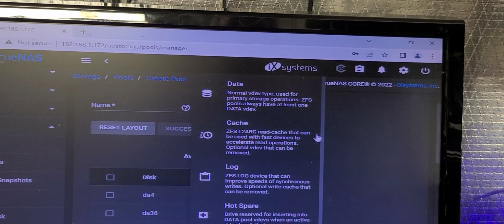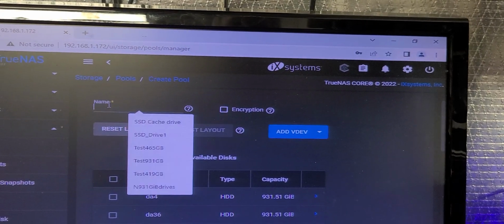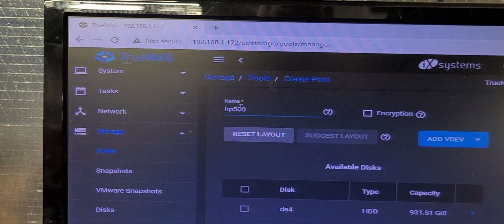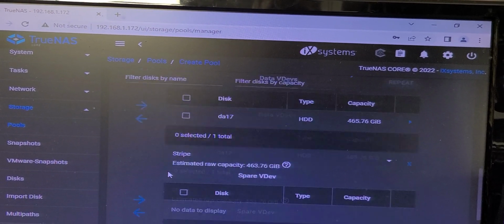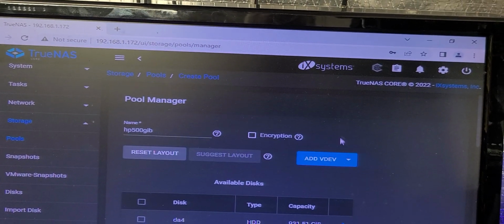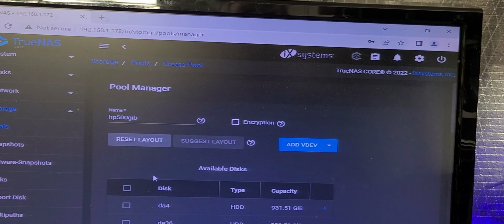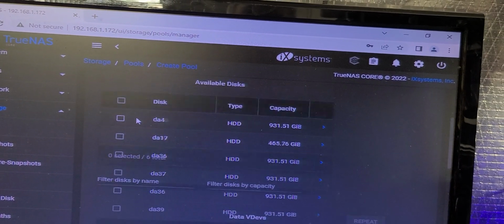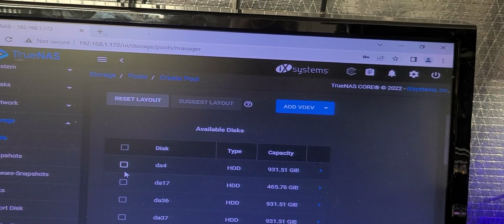Well, you can actually go into and create hot swaps, okay? And by creating hot swap, 500 GB, I can then state and configure this drive to be what I want it to be. And in this case, I want to enable the hot swap capacity. And I'm going to bring him out real quick. I apologize for that. Bring it out. Okay, set to hot swap state. Yes. And bring it back in.